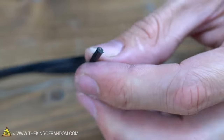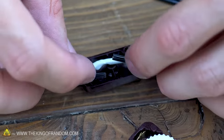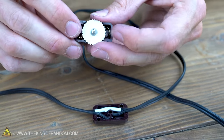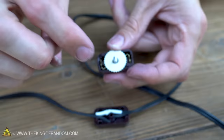Let's trim off the extra cord so it gets divided. This little piece of plastic is designed to keep the two pieces separate. The other side that we place on top has prongs on both sides, and these are designed to stab through the rubber of the cord and make a connection between the two sides.